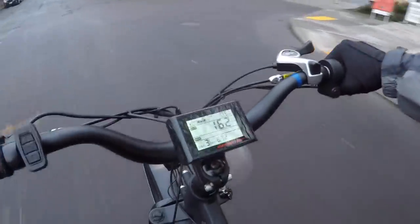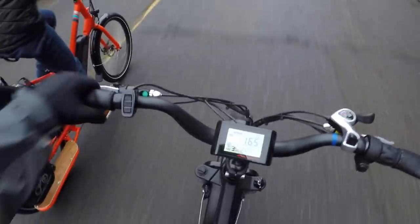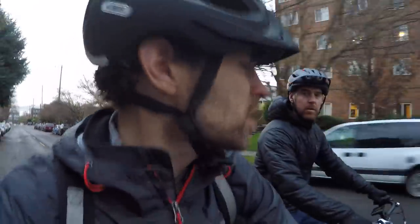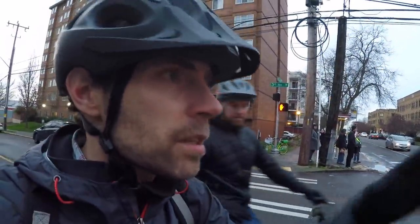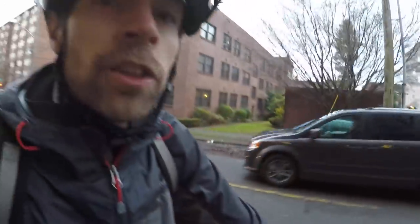It's getting a little bit darker now, and I wanted to show you what the display panel looks like and also how stable this thing is with the wider tires. It's kind of a fun go-anywhere machine and they've been really popular in the United States for that reason. Also a little bit more comfortable — there's that nice suspension fork up front with 32 millimeter stanchions so they're a little bit thicker. The fork is actually a custom RST fork made specifically for the Rad Rover. Just like the tires, they do a custom arrangement with RST including that lockout with preload. If you lower the tire pressure, you can use this thing on sand or snow or loamy terrain and it floats pretty well — I've actually tested them in snow and sand in Cabo Mexico and they worked well, going through soft dry sand at five PSI.